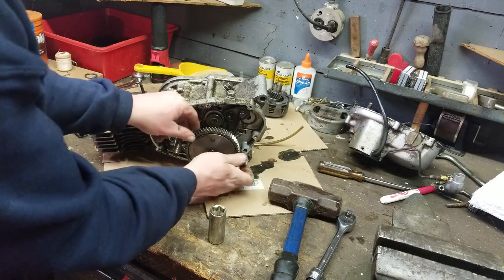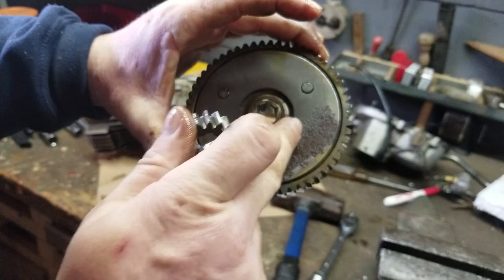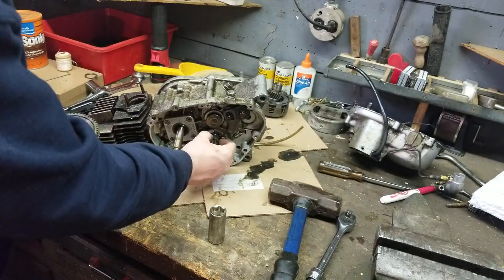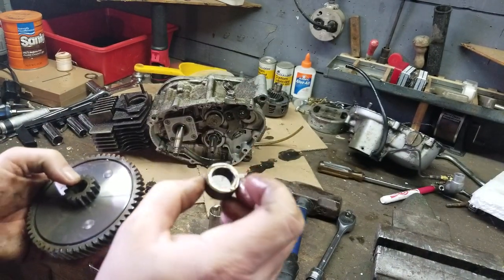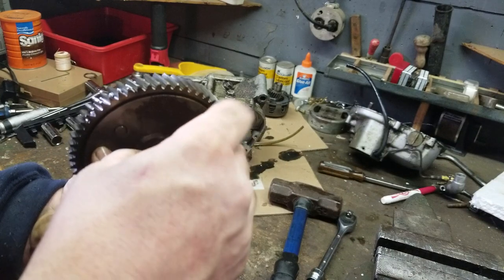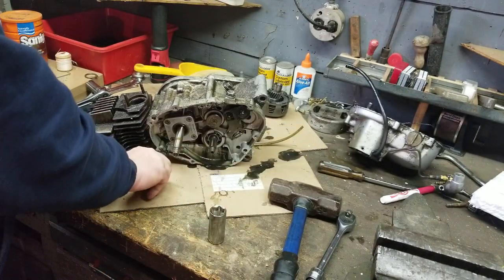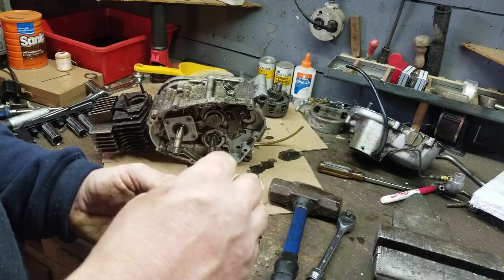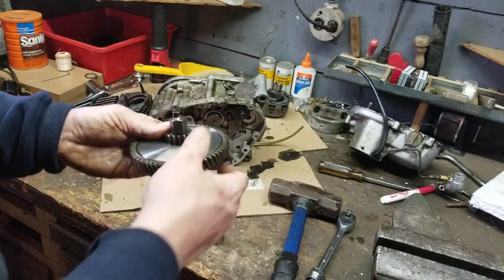You have your gear. And your mask gear, you can see the rust on it, which we're going to clean all that off. As you're pulling them apart, you're inspecting them, making sure that they're not worn out. And you're going to put them back together in the order that they came out of. And I'm going to be using, like I said, a zip tie around them. The nut I can't zip tie, but it can go in the same baggie.